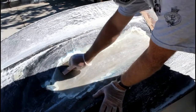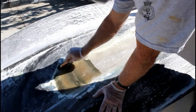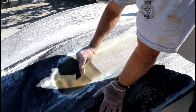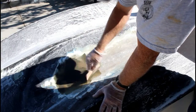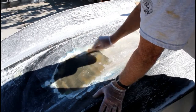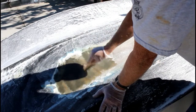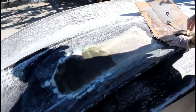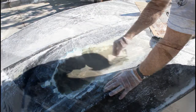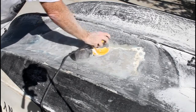In addition to sanding, this is an option: you can coat the entire surface with a fiberglass bondo — it actually has fiberglass strands in it and it binds very nicely. Again, I wiped it down with acetone first, and then you can lay on a really thin layer of this fiberglass bondo and sand that off. That's going to fill in any of the tiny scratch marks created from the rough grit disk sander. Then I went back over that with the same oscillating sander.